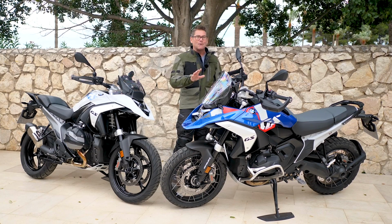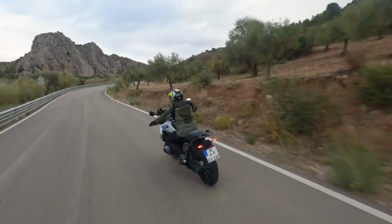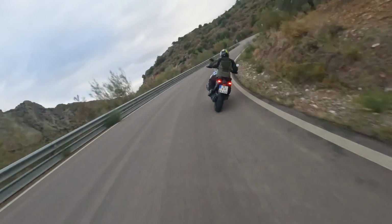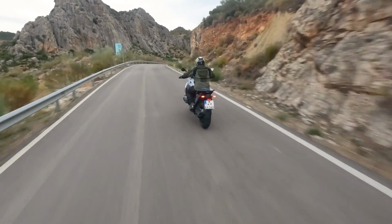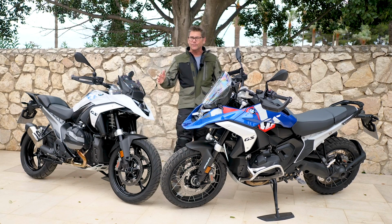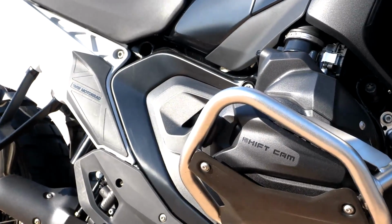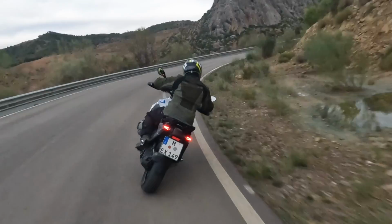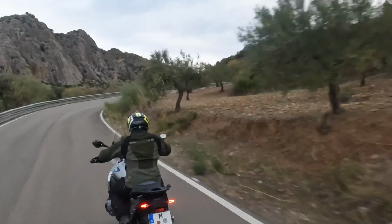Third big impression is the motor. There's more motor, and the Boxer engine is iconic for a lot of reasons. Now it's even been changed more. The transmission is now under the engine, so it's lighter and more compact. There's additional displacement, now from 1250 cc to 1300 cc exact, with more horsepower: 145 horsepower, almost 110 foot-pounds of torque, and the torque spread is really wide. With the ShiftCam technology, which adjusts the intake cam, you can stay in the same gear from 20 miles an hour to 80 miles an hour if you like, and just have that real toothy grin feeling of pulling out of the corners. So the torque and the motor have just made the riding impression fantastic.